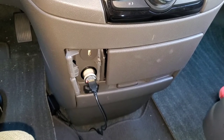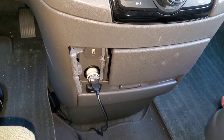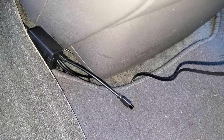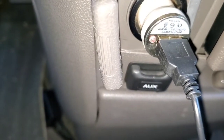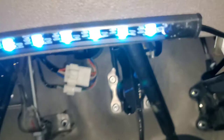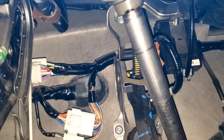I got done installing the front of the car with the two LED strips. Instead of mounting the box, I just left it underneath because I didn't want the wire to be visible. The only wires I wanted visible were the antenna and the USB connected to the power port. For the driver's side, this is how I mounted it — since there's nothing under there to place the LED strip, I tucked the wire behind that plastic and ran it under there.